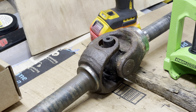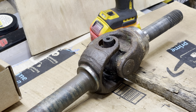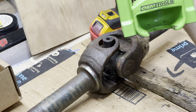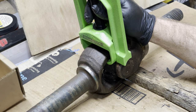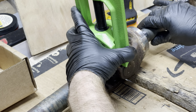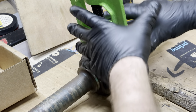This particular part was probably the worst for me because I ended up damaging one of the yokes using a traditional C-clamp style press, which you're really not supposed to use on these. I got one of these off Amazon — these are u-joint pullers. This one is OEM Tools 24548, heavy duty I believe. If you've got an Excursion or one of these Super Duties, you probably want to get this one if you're going to pull u-joints — 24548.